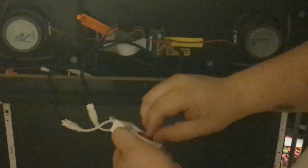And then I took off that 3 millimeter 3M tape off the back that he provided, stuck it right underneath the back box above the bottom access panel door, stuck it there. Now, with the actual back box door, you're not going to be able to get all 9 screws back into it. What I did was I did the top 3 and the 2 side panels. The bottom 2 screws in the bottom left corner of my back box, I was not able to put back in because of the wires that are protruding on the outside.